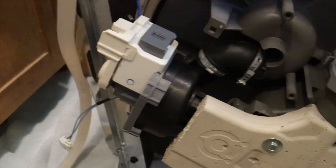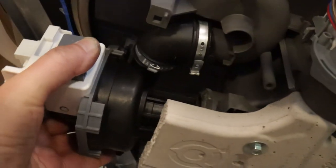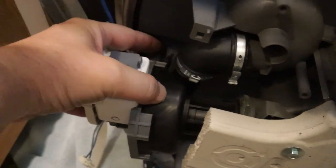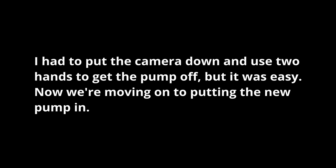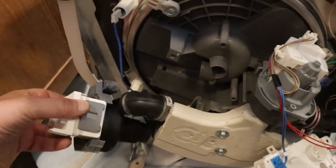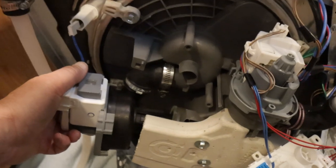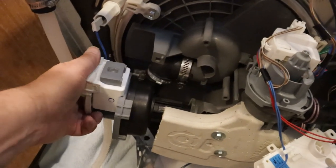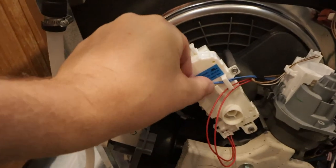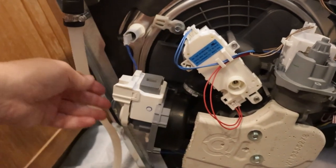Let's get that pump off — let's see if I can just pull it out. Oh yeah, that's it. So basically we just slide the new one back in, make sure those wires are in the right spot, and do up the hose clamp. Don't forget to put the hose clamp on before you slide it on, because then you have to pull it off again. That just slides in there. Make sure you reroute these wires the way that they were. That went in smoothly. The hose clamp is tightened and the power is connected.